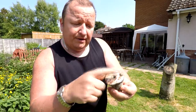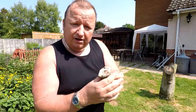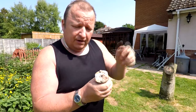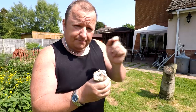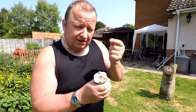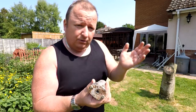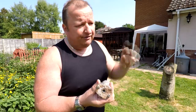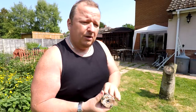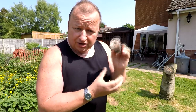Although it didn't break these little pins, look, they're supposed to break first, before any other damage, and also the crank, the cam, the flywheel, is all supposed to break the little aluminium woodruff key that sits in there as well. But as I say, to do this, it really must have hit something hard. And after that, people lose faith in it and they probably say, oh, that's it, get rid of it, let's get a new one. But we've restored it and it's back and it's sold again now. Not with these on, obviously.